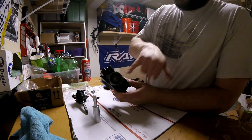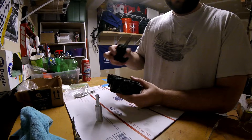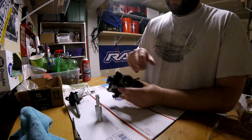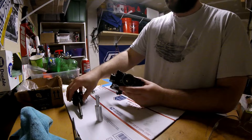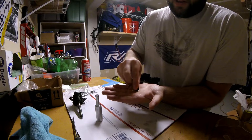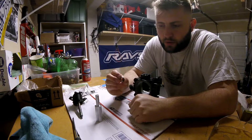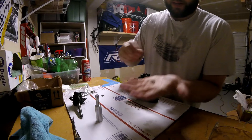The main thing I want to talk about today is the throttle body shaft seals. What they are are the seals that sit in here, here, and here — for the throttle body that the plate and the butterfly turn in. This is basically what seals off that gap between the shaft and the seal. This is what an OEM one looks like — you can see it's made of rubber, it's kind of brittle, and it was pretty easy to pull out when I took mine apart.